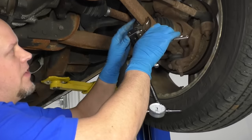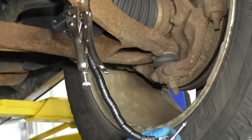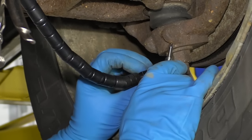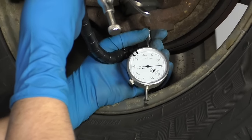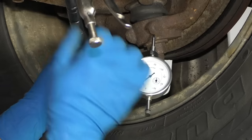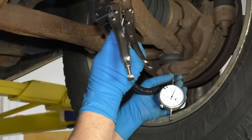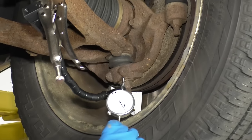What we're going to do is hook this locking plier side to the lower control arm here. Then we're going to take this gauge and put it on the knuckle side right here. There are a lot of adjustments with this tool, so it's easy to lift the vehicle and get this tool set up first. Then I can lock this down right here. We want to make sure this stabilizes — might have to tighten it up a little bit. Make sure the gauge isn't touching the tire, and that looks pretty good.